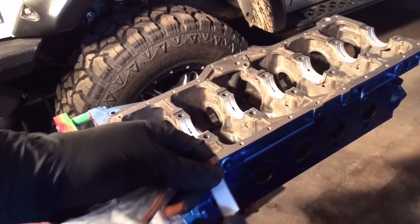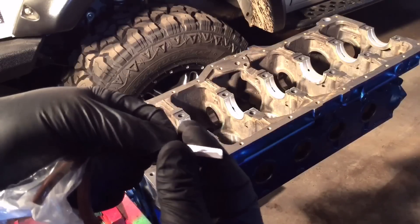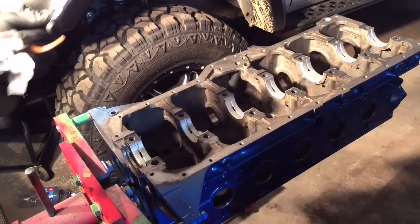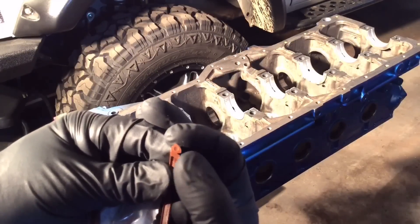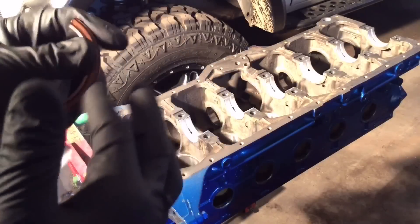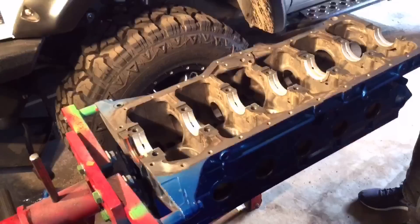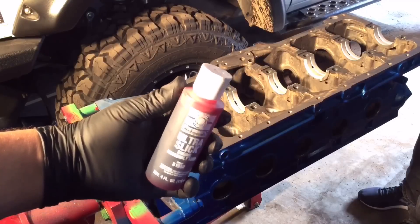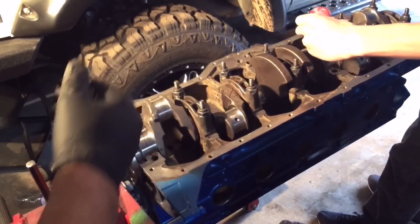When you open up the package, you'll find this little shoehorn guy in there. That helps you feed this rear main seal in, in case you're trying to install it with the crankshaft already in the vehicle. You put a little crease in it, sit it in there, feed the seal in, then peel that shoehorn out. If you look at the seal, it's got a little lip to it — the larger side with the little teeth on it faces the front of the motor. We're going to put some Permatex Ultra Black on there and slip it down in the groove. Don't get that glue anywhere but on the back side. So with the rear main in place, put the Permatex Ultra Slick on every bearing — don't use it sparingly, make sure to lube them all up with a good healthy coating. Smear it around.